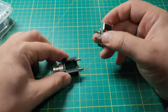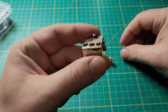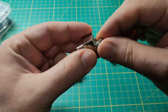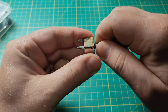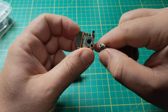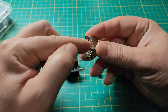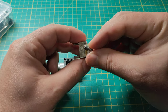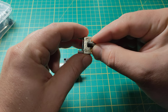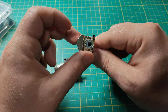Also, you have to keep in mind — if you buy this, you will have to stick with this type of nozzles. You can't put anything different inside, unless you treat it so the thread goes through the hole of the heat block. Somewhere in the middle there is a groove, some kind of lump, what prevents this nozzle from going in, or actually putting the throat deeper. So in order to meet those two parts together, they're not gonna be in the correct position, it's not gonna seal, so you might have some kind of leaks of plastic.